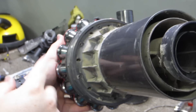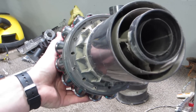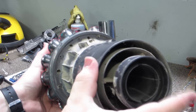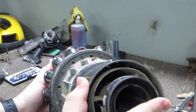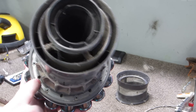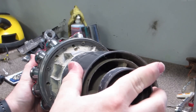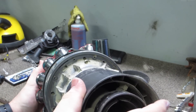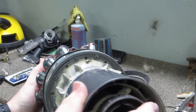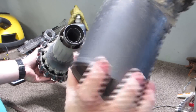Just so you note, if you are trying to take one of these apart yourself: all of the screws — both that hold the shroud in and that hold this piece of the cyclone in — are all exactly the same size. There's no sorting; you can't put them back in the wrong spots. The screws we're taking out now that are hidden in these alcoves constantly end up hidden by dust. When you pull on this piece it should slide completely freely with very little resistance — if you're getting resistance, don't pull, as you might have left a screw behind.